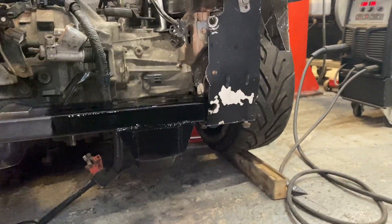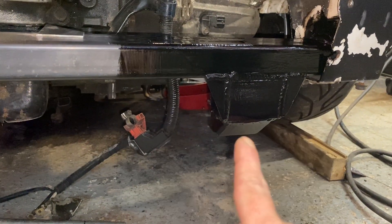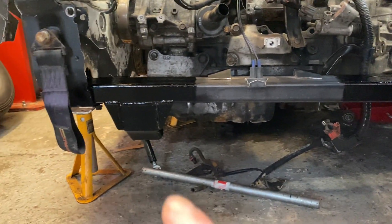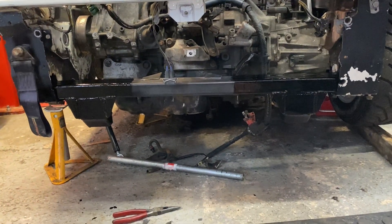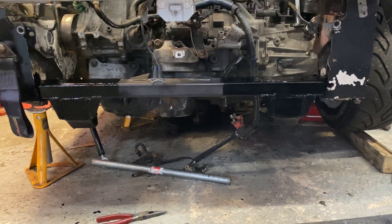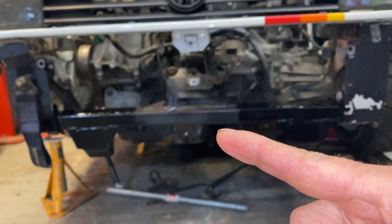So to show you the kind of finished result — I've cornered all these in now, so it plates all the ends of the box section, it's reinforced, everything's fully welded. I'll give it a quick coat of black paint just to seal it in. I've left the middle area because I'm still going to make the engine mount. That there is the two front stabilizers for the tie bars done and dusted. Some of the welds could be better if I had my TIG welder here, but it's not here at the moment — it is what it is, it'll work, it's strong. So now let's get on with the tie bars, get them finished, and then look at tying this front mount to this front cross member.